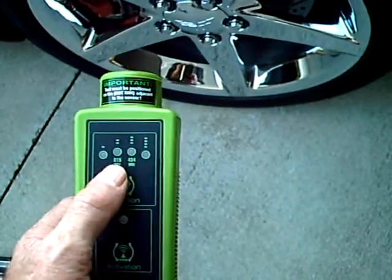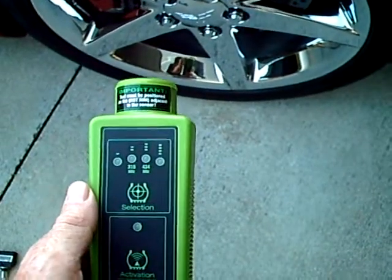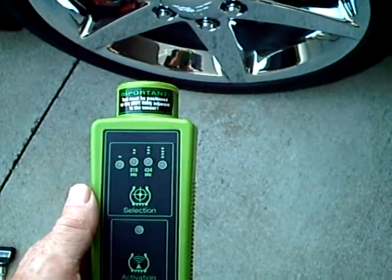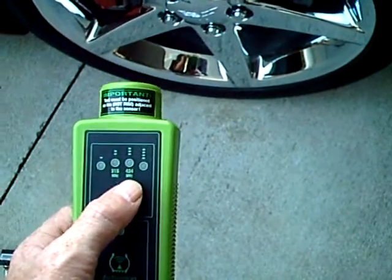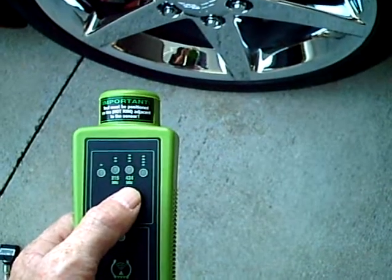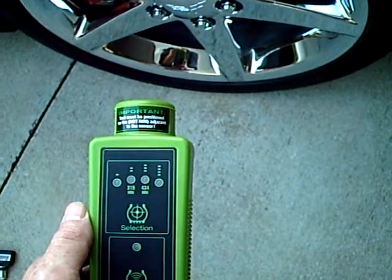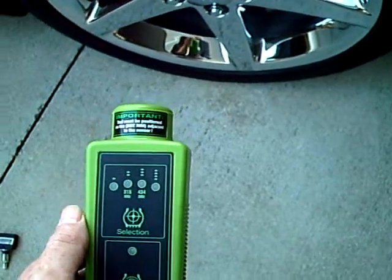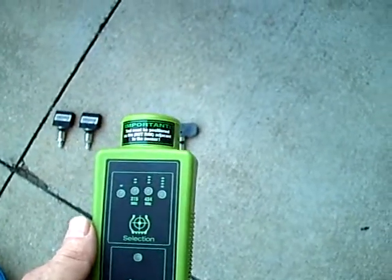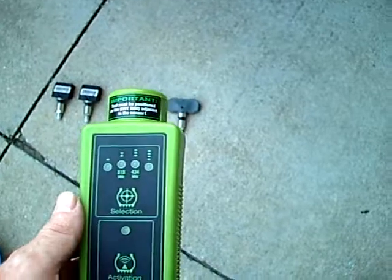The 315 light flash indicates that the sensor was transmitting to the TPMS on 315 megahertz, ultra high frequency. European cars use different sensors that transmit to the TPMS on 434 megahertz — that's our C6's as well. They have a different TPMS and require a different sensor, part number 25758221 instead of 8220, which we use in North America.